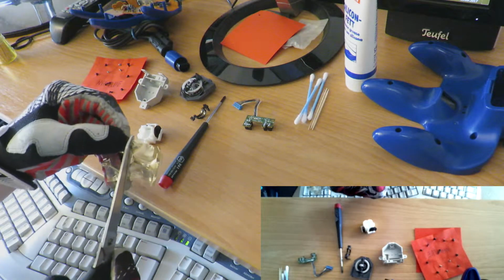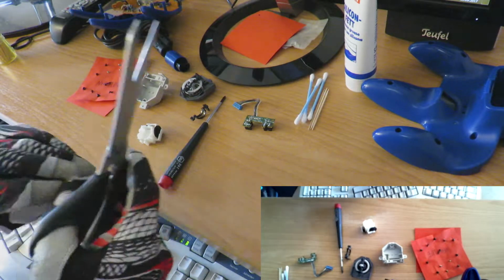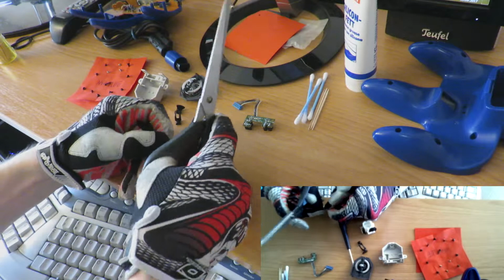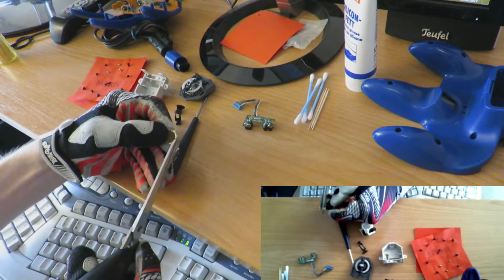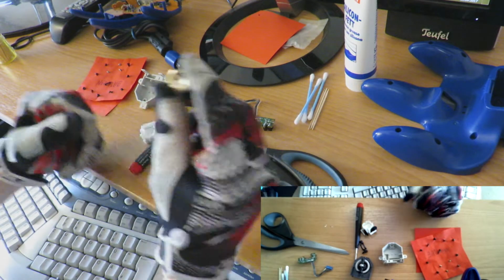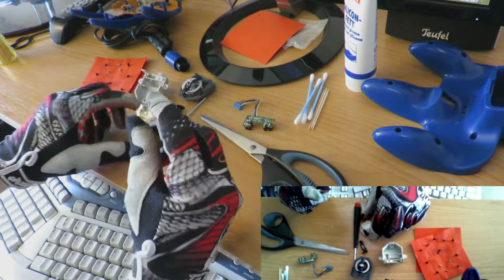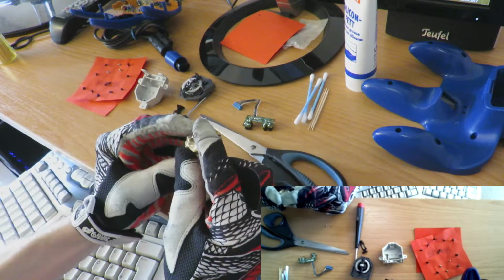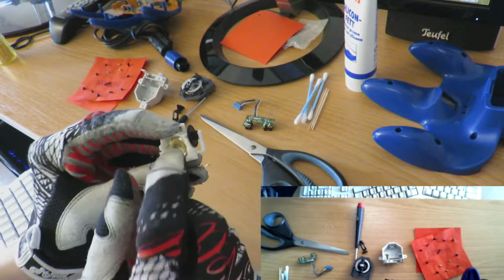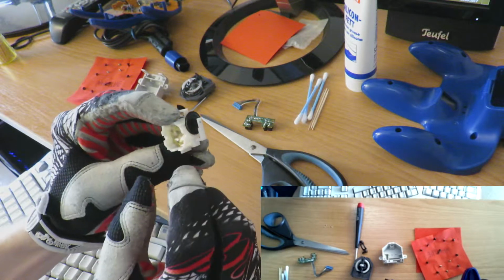You want the stick to slide over the edge of the Toffifay disc, also the plastic, or it will bend it and the controller gets stuck, and the repair starts again. If the floor is very grinded and destroyed, maybe you need 2 or even 3 Toffifay discs. You have to test around. If it's too much, your stick will become stuck and won't move properly.